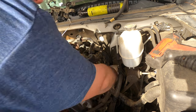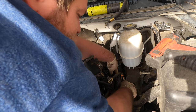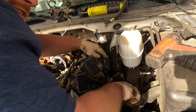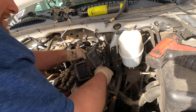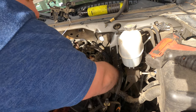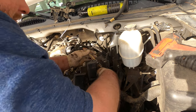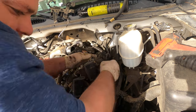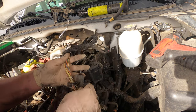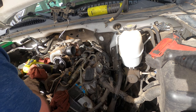And then down here, it's zip tied to the fuel return line. We're gonna have to cut that. Not the line, the zip tie. I should replace those, but I didn't put them on the order. Probably gonna have to tape up and loom this harness. This one's pretty rough. Especially right here, if I leave it, it's just gonna short the injectors out. And then it'll come back and this thing will fall.